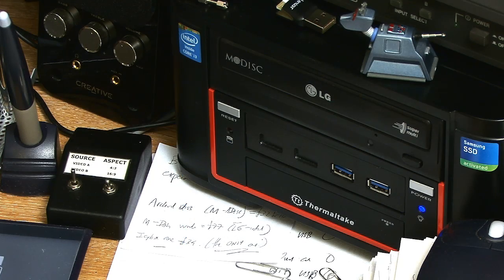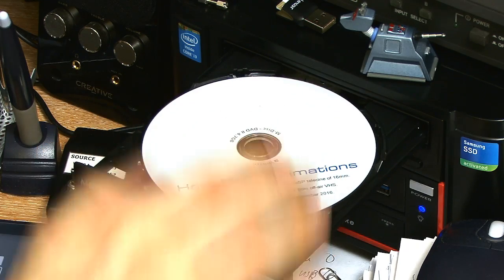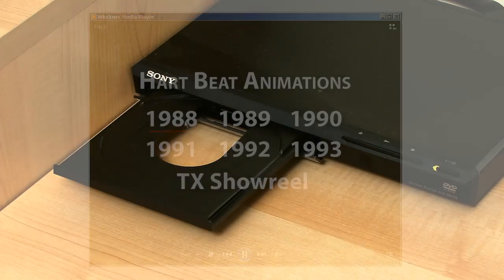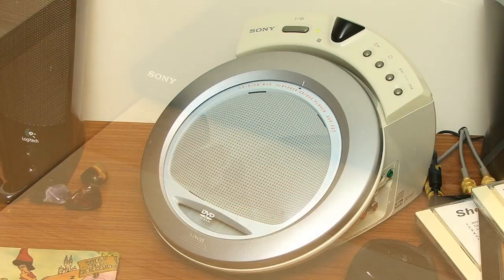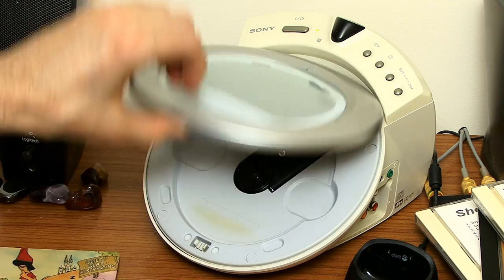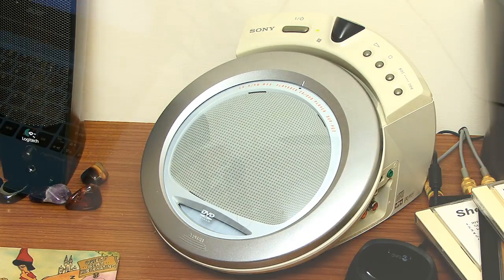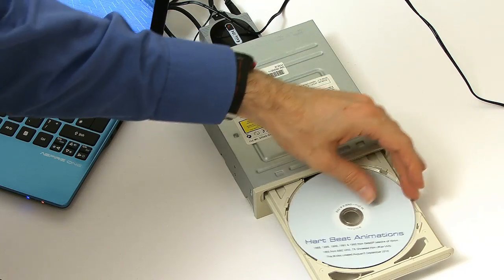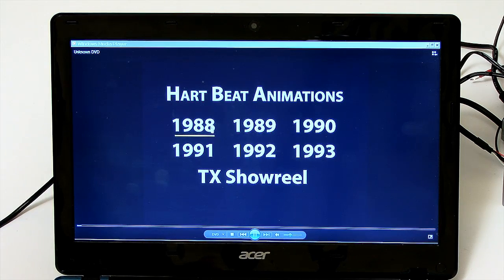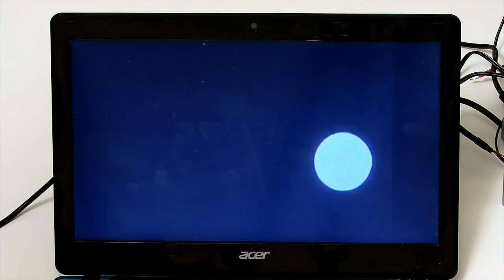I've also decided to write a DVD to check compatibility. I've written a video disc so I can try it on lots of different drives. The first one I tried it on was my i3, which was bound to work since it's an M-Disc certified drive. I also tried the disc on a fairly new Sony DVD player — it worked fine. And I also tried it on an older Sony DVD player, which I think was made by the Romans — and surprisingly, the M-Disc DVD worked on that as well. I even tried reading the disc on a very old IDE Samsung DVD drive connected to my netbook, and to my great surprise, that also worked. So although it's claimed M-Disc is not entirely compatible with all existing DVD drives, I couldn't find a drive that wouldn't read an M-Disc DVD.